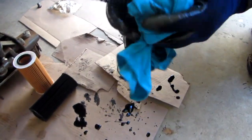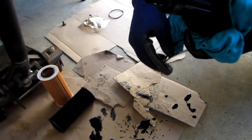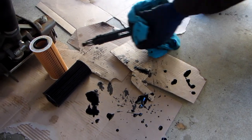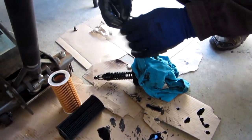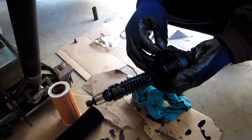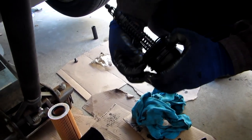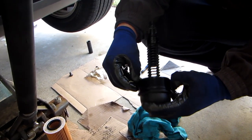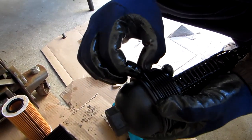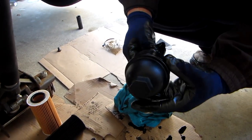Now that we've got this dried down a little bit, this is the new O-ring. Before we put it on, it's good to lube it a little bit — just get some oil from your drippings, you always have extra oil. Just lube it up a little bit. This one you put in from this side. Make sure it goes in the right groove — don't put it in the wrong groove. This one big groove here. Just stick it there and pull it around. There you go — nice and oiled. Make sure it's in the right groove all the way around.